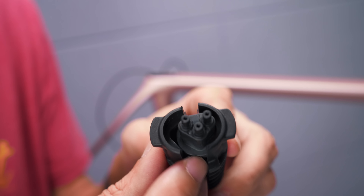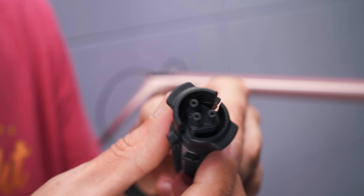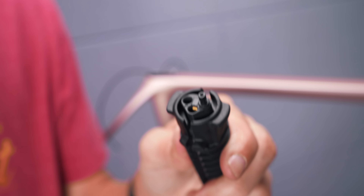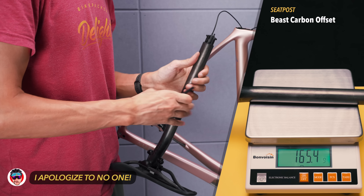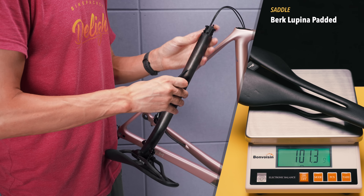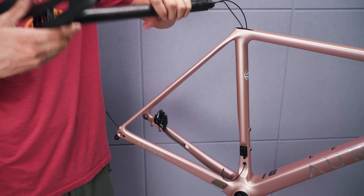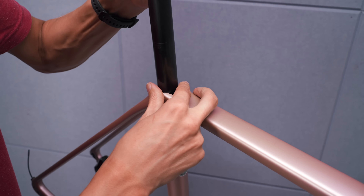For the Di2 battery, Dara had gotten the new battery holder for the DN300 battery. The old version of this and other similar holders does not fit over the new 3-port battery without some kind of work with a knife. I wonder if it was just luck that he got the correct battery holder or not — but kudos, Dara. Two ports will be used here and Shimano specifies to always use the center port for one wire, although I have just used the two on the sides for symmetry reasons. This worked on my first install when I didn't know about the Shimano recommendations, but it's always better to follow those — so one cable in the center port here. The unused port must always have a plug, otherwise the system will not work, as I also discovered on my first firmware update.